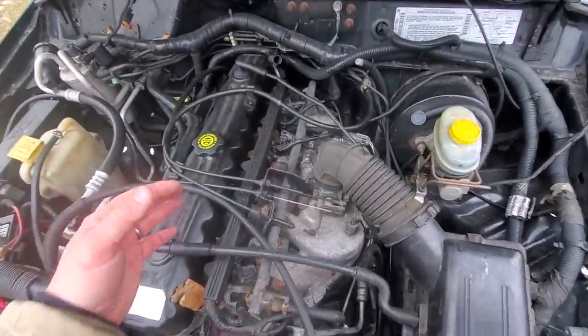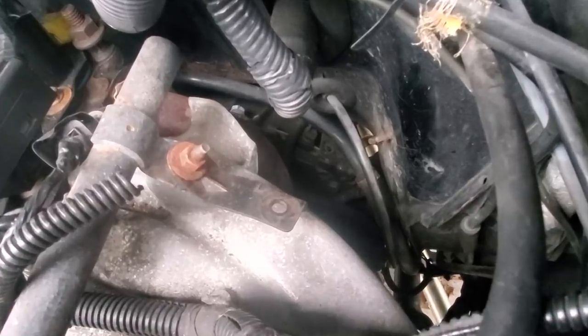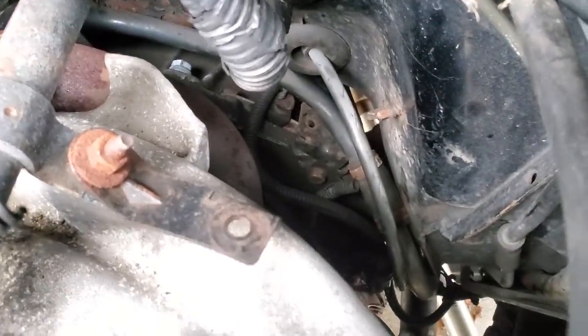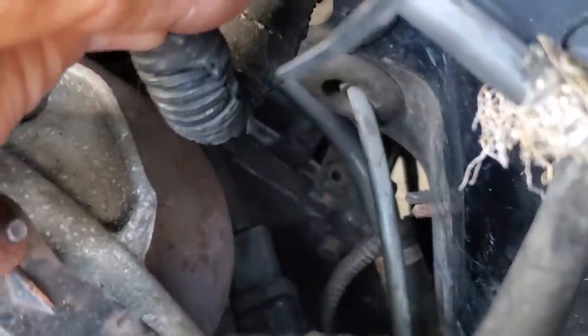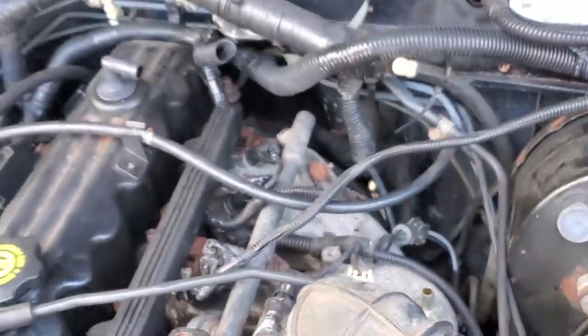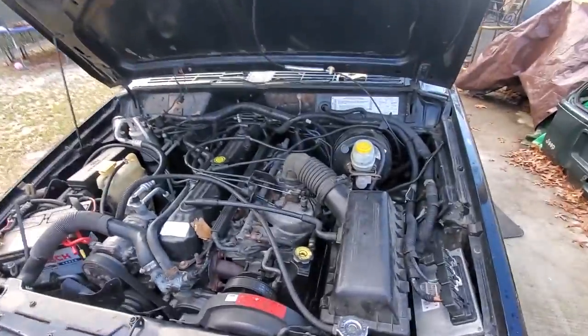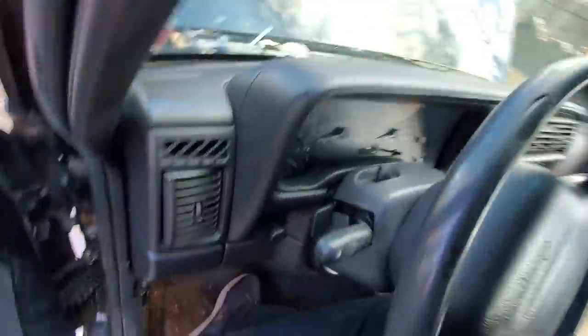Finally, last but not least in the ignition system would be the crankshaft position sensor. That is way down in there and it is really hard to get to. There's one bolt right there, the other one is blocked by this little clip area - you clip on your harness to that thing when all is said and done. They are two 11-millimeter bolts and they're facing the back, so it is just a real pain to get to. I know Project Wreck-J starts and it's an automatic of the same year, so I think this will be a good vehicle to swap with.